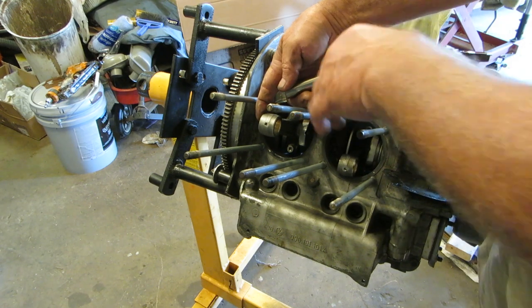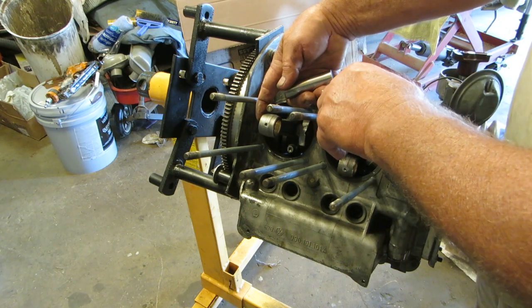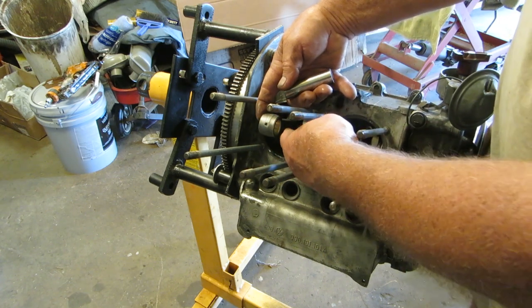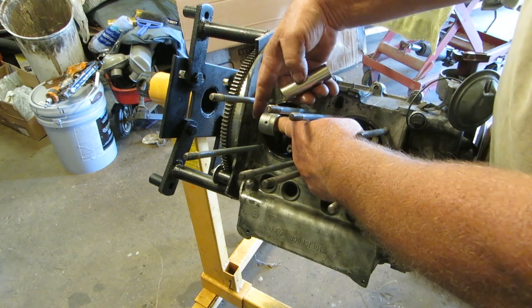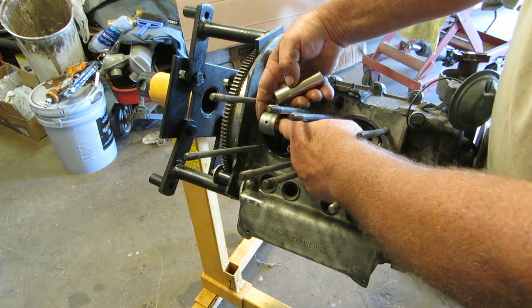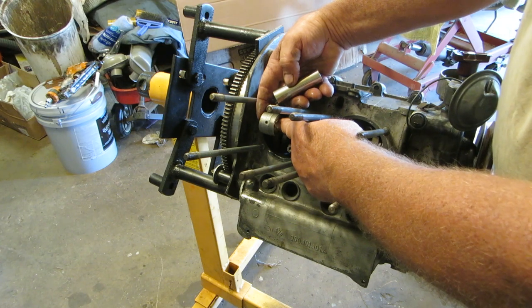You're gonna rough up these pins, and they're not gonna want to come out of the pistons, and you're gonna ruin a piston set for that. So don't do that. Wait the time, or buy some new rods, or find somebody who will bush them for you. If you bush them, they have to have a new pin. If they do it right, that is, because the bushings just come rough, and then they have to be cut once they're pushed in.